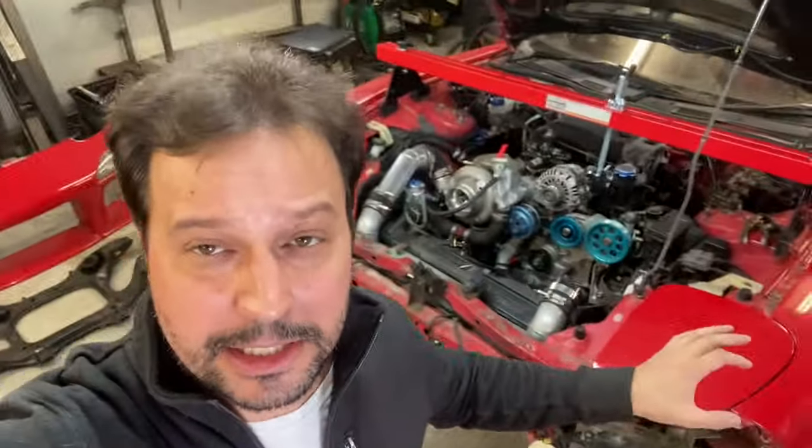Back at it in the garage. This is episode 2, part 2, whatever you want to call it. We're getting the front cover off the engine. As you can see, I've already started dismantling everything. I'm going to try to leave the coolant system alone — I did flush it just in case — but I should be able to sneak that front cover off. Once we get that off, along with the oil pan, we'll be able to inspect it. You guys told me in the comments: what do you think is wrong? It's either bearing, could be a worn bearing — highly unlikely but possible. Did the front O-ring in the front cover blow out? Is the oil pump the failure point? What do you guys think is causing insufficient oil pressure while running? Love to hear from you. We're going to get to it in this video, take the rest of this apart, see what we got. Let's get after it.